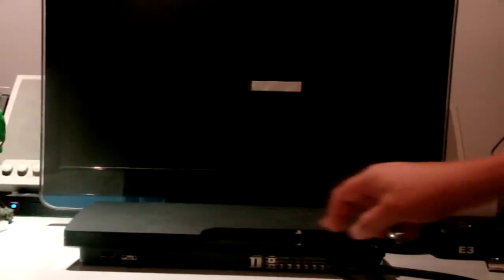Okay, press power, then eject. It will boot up. Ten seconds later it will turn itself off again. Everything went fine, as you can see, and now it's off. Okay, now we put the first stage of the flash stick in. This will put it in factory service mode and start the downgrading process by installing our custom firmware.